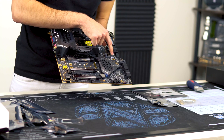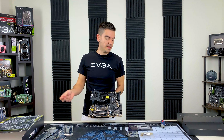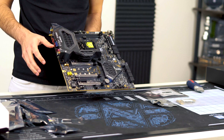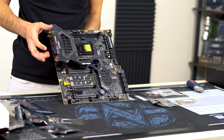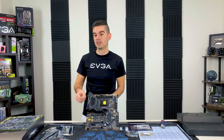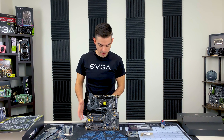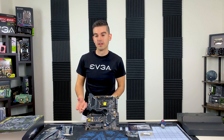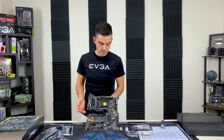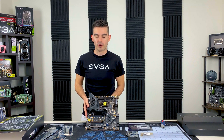This last switch you've probably not seen before — it's a cool one. It works in real time, so you can use it in Windows. It has two positions: normal and a base speed. Basically it locks your CPU down at the lowest possible frequency, at that lower C-state. There are instances where you're trying to open up all your benchmarks and you're not certain of stability — you can do that at low clock frequency. Get everything set up, then flip the switch into that overclock and run your benchmarks. That's how committed this board is to extreme overclocking — that overclock may only work for one or two benchmark passes, so you want clocks down when you don't need them, then switch to full clocks and run those world-breaking benchmark runs.